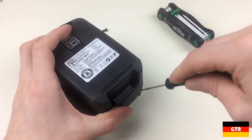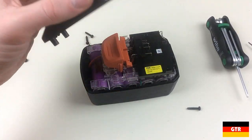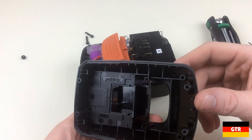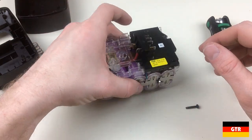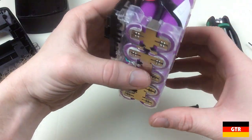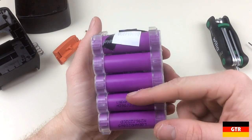After popping that out and taking out the last screw, the unit comes apart. This is a well-constructed battery unit with a PA6GF30 outer housing and a polycarbonate inner housing to protect the batteries. The battery pack uses 18650 batteries arranged in two 7.2-volt and one 3.6-volt cells. The 7.2-volt cells contain two parallel sets of batteries in series, while the 3.6-volt contains a single set of batteries in parallel.